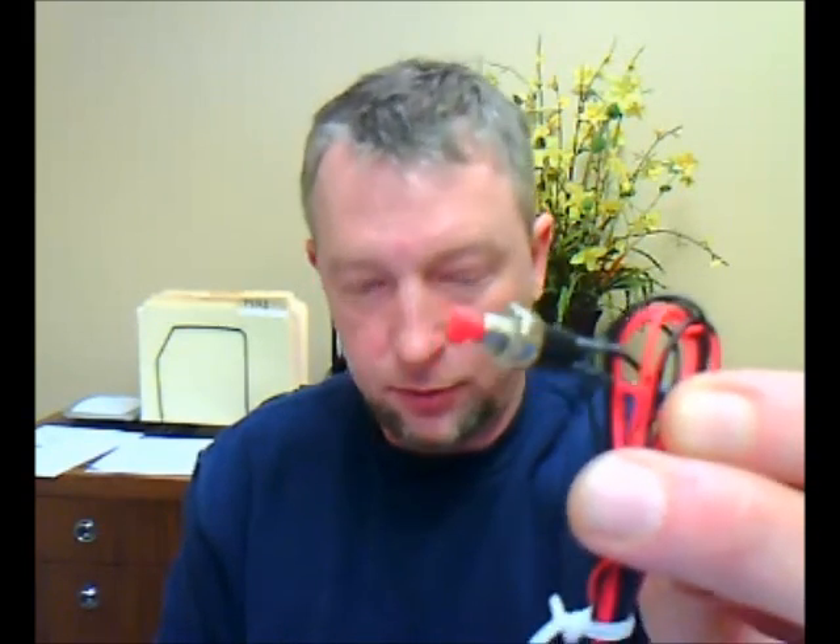It's going to look kind of like this — maybe not exactly, but like this. What it is, you only see this piece — it's a push button, momentary style switch. It could also look something like this: a black one, red one, whatever. This is your valet switch. So now let's just say you open up your car, you turn the key to the ignition position — you're going to want to press this five times: 1, 2, 3, 4, 5 — your alarm should shut up and cease at that point. Now from there, turn the key off, turn it back on, push it once. You should get one chirp from your alarm siren, and the LED on your driver's dash should stay on solid. That's what you need to see before you can go forward programming your remote.